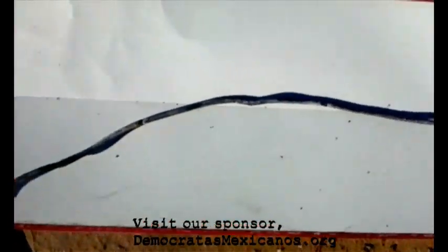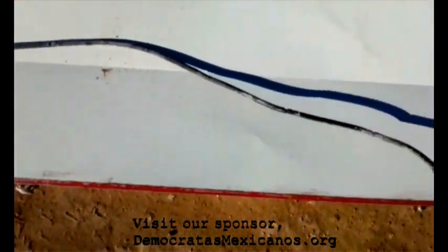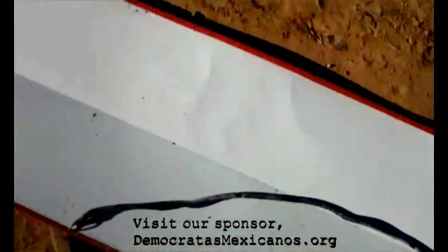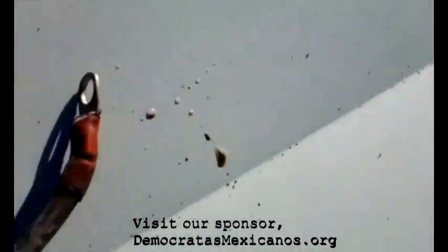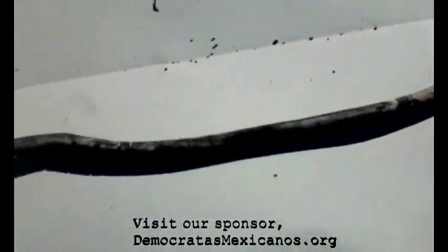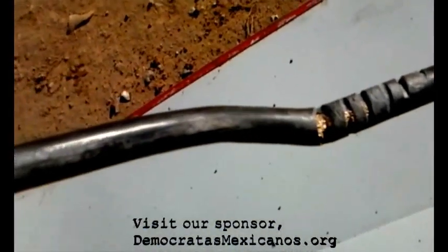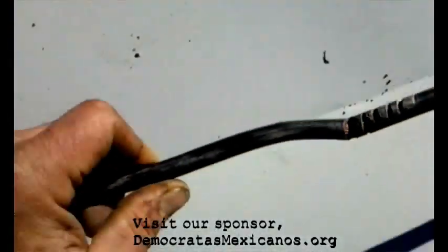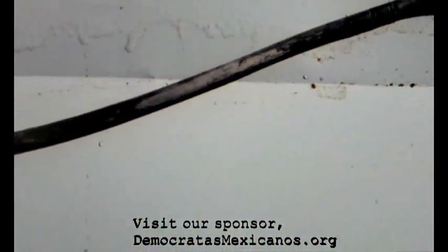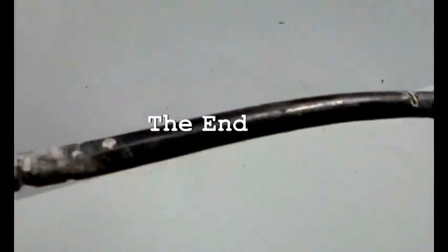Here's your negative ground cable that runs from the alternator to the starter. At the starter connection, six inches down you've got a break, and a little further there are more breaks in the insulation — same thing further along, and the same thing again. It actually gets worse further down.